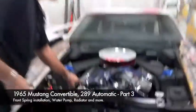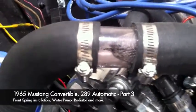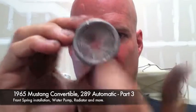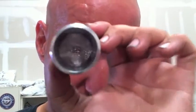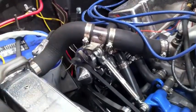Right there — see that? See how it goes away? What happens is the water goes through here from the engine, and it's a catch-all because it's got this tight screen here. It's not quite as angled — this is kind of like a nipple right here. Extreme Mustang Medic close-up. You want the water to go through the nipple, so the nipple is facing away from the engine. When you turn off your engine, the water goes back and gets caught inside this filter.